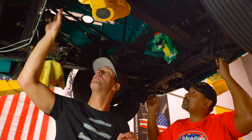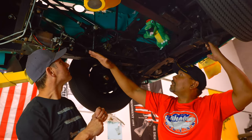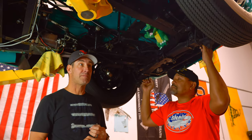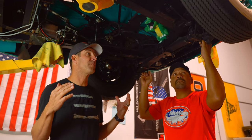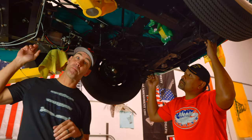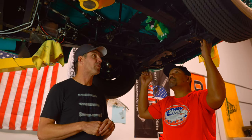We have all this room back here for a couple of batteries. They want to upgrade this vehicle in a lot of different ways — not just electric. We're going to put a power steering column in this, and also power brakes, because we are adding weight to the vehicle and therefore need more braking power. We also do have regenerative braking, but we can't rely on that all the time, so we have to upgrade the brake system as well.